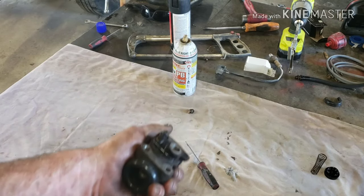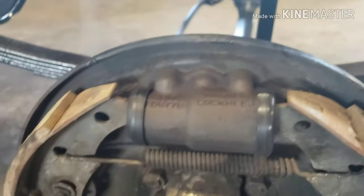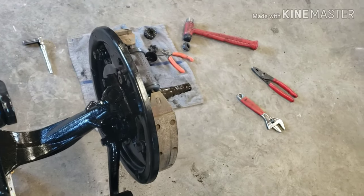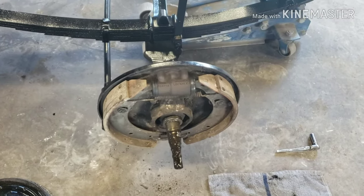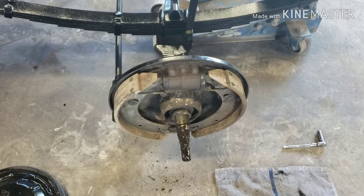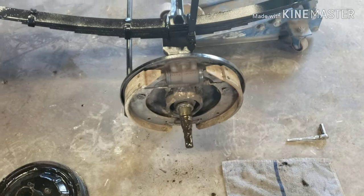We've got it back in the truck — you can see it with the brand new boots; it looks like a brand new wheel cylinder. The boot kit was only about seven dollars, and the wheel cylinder was about $25 a piece. If we had gone with the Ford model we found out we could use, this was definitely a lot cheaper and didn't take much more time — you'd still have to go through all the cleaning and honing steps anyway. It's still worth it when you're doing all four cylinders. I'm going to get the hub back on, then get the other side done so our front axle is ready to go and our brakes are right.